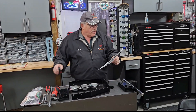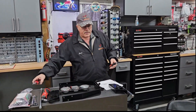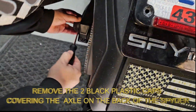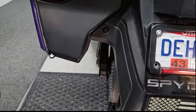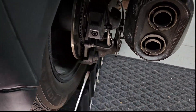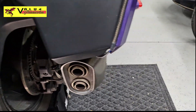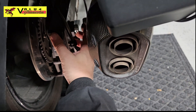The first thing we're going to do is remove the two plastic caps, and then remove the cotter pin on the right side. We'll come around here and show you — I'll turn the light on back here. We've got these axle caps here; these are not going to be put back on afterwards, so take those off just like that. Down here we also have this axle cap, and it's a little bit tight with the muffler there. I'm going to take a minute and take this cotter pin out — all I'm going to do is twist it around and pull it out.